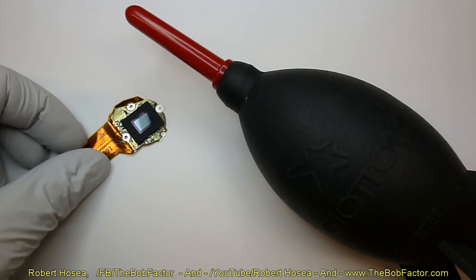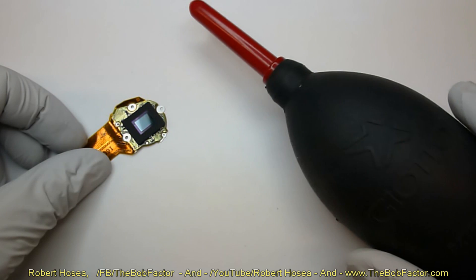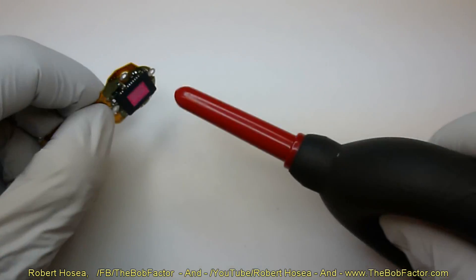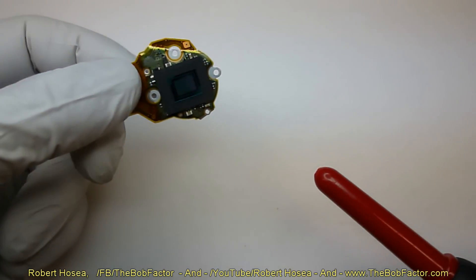When it comes to cleaning a CCD or a lens that just has dust — not a smear or smudge — my policy is don't touch the lens or CCD with a rag or a brush. Many times you'll just add more stuff to it. Just use air, but you can't use compressed air — compressed air many times has oil in it and you can really screw things up. Use something like an air blower. Blow the dust off first, because if you can, you're way ahead. Also blow the circuit board and everything off so that if there's dust on there, it's not going to get back on the CCD after you put it back together.